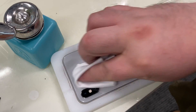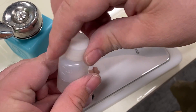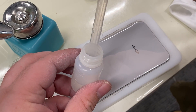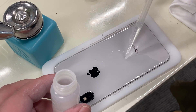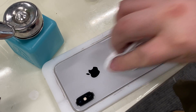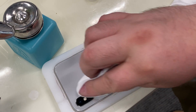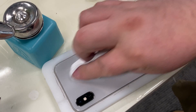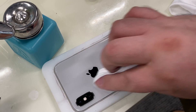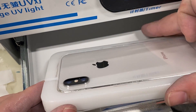So we'll give it a good thorough cleaning, and then we'll apply a new layer of oleophobic coating. It only takes a handful of drops, but these do evaporate fairly quickly. So it's important to quickly take a microfiber cloth and go over the entire surface of the glass. The oleophobic coating is also cured using UV light, and it only takes 30 seconds under the light to do so.